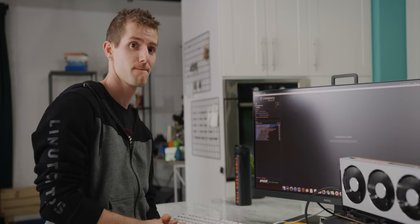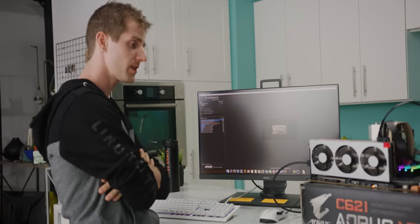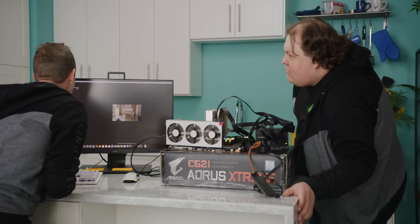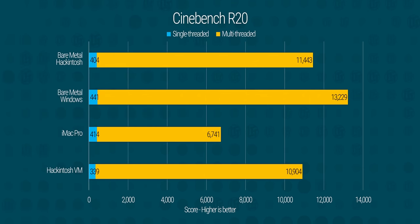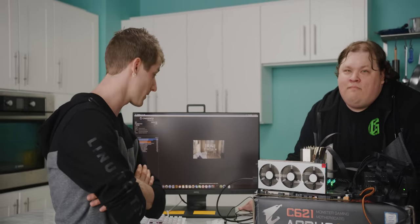I think last time we cracked 10,000. I would expect it to be at least a touch higher because we're ditching the virtualization overhead and we've got a couple more cores since we don't have to leave anything for our host OS — so four extra threads. We got 11,439. We're looking at results about 5% faster in the multi-threaded test and nearly 20% faster single-threaded. As much as we love virtualization, we were actually leaving a fair bit of performance on the table.